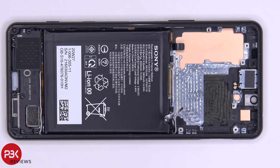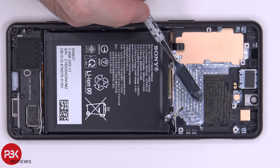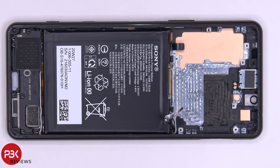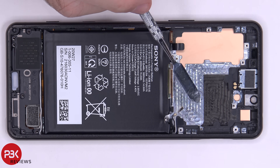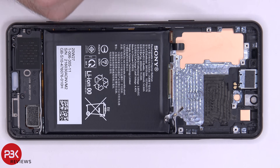Back to the mid-frame, there seems to be some copper tape in between the screen and the mid-frame, but no vapor chamber or any copper plate on this side of the mid-frame. So basically on this side the thermal pads will just help transfer heat to the mid-frame, and the graphite film will help transfer the heat to where this copper tape is underneath the cameras.